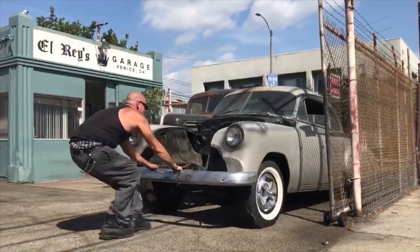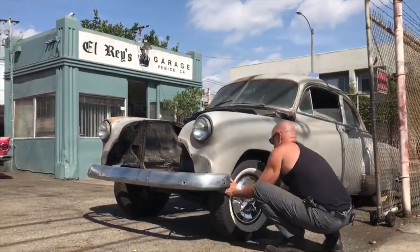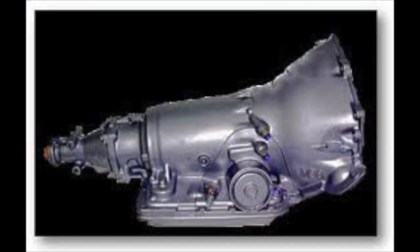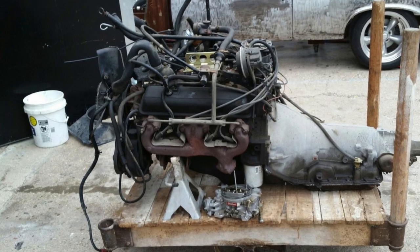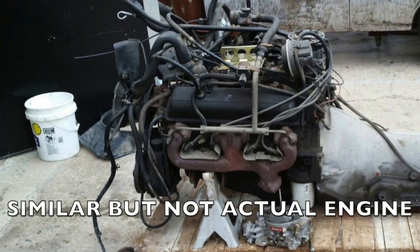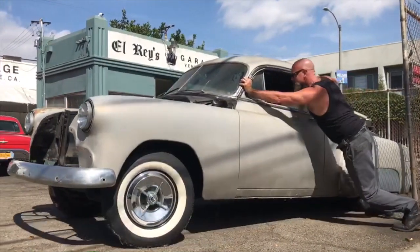Because the parts are plentiful and should be easy on our limited budget, my first choice for a drivetrain is the tried and true Chevy 350, mated to a 700R4 automatic transmission with overdrive. The first thing I did was find a suitable donor engine to tear down and build to what I believe to be a strong yet somewhat mild build — reliable for years to come with plenty of power for everyday use.